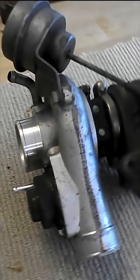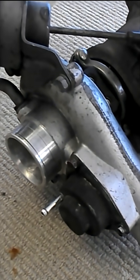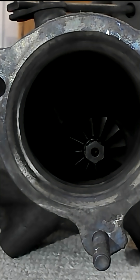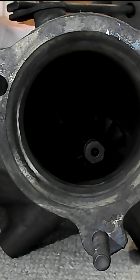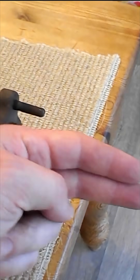At the same time, on the compressor side or the cold side, compressed air is fed into the engine air intake. As the exhaust gases enter the turbo, the housing gets narrower and narrower, and this speeds up the gases. The gases then force the turbine to turn, and they exit the system through the exhaust.